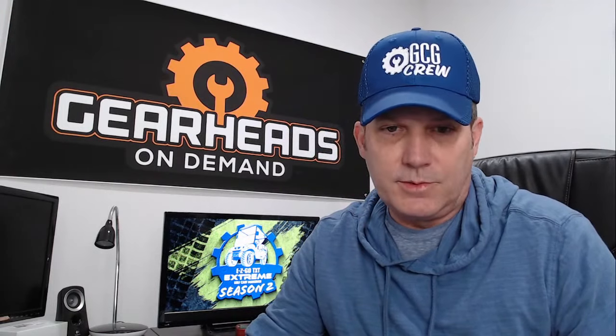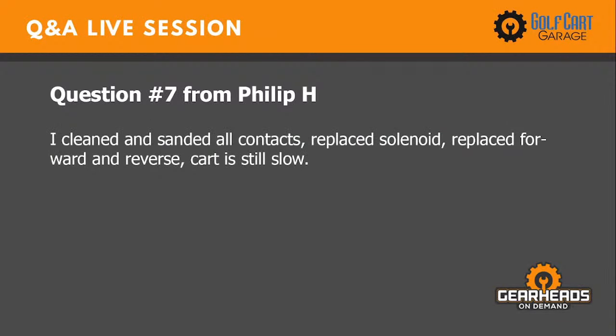All right, let's see, number 7. I cleaned and sanded all contacts, replaced solenoid, replaced forward and reverse. Cart is still slow.